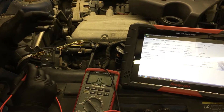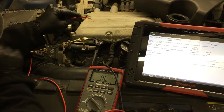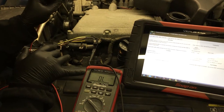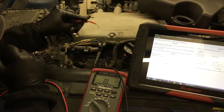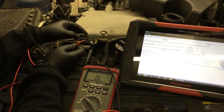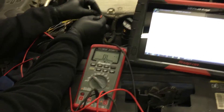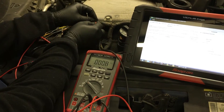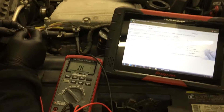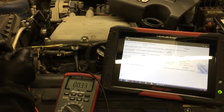I've replaced the wiring and was still having a problem getting a signal, so I've come to discover something else. I've got this grounded to the engine to simulate ground 105. You can see I go from overload — because it's open circuit — and when I close the circuit, I do get an ohm reading. I'm going to go back before my added-in replacement wire, pierce the wire, and yes, we're getting a ground. I'll do this again on this side of my wire to make sure the wire I put in is okay — and there we go, we have a ground.